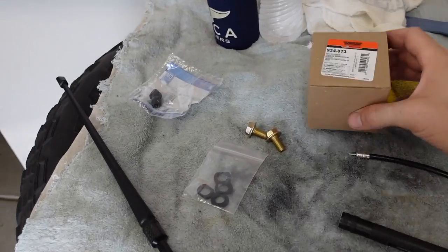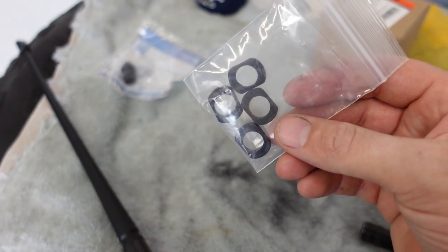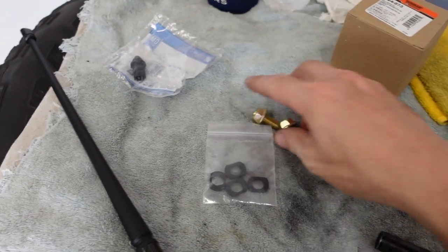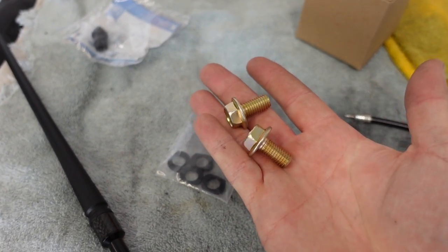Alrighty, so the kit for the seat is from Dorman. That's the part number right there. I will link it in the description for you guys. It actually comes with two seats worth of spacers, and I do have to do the passenger side, because that one is loose as well. It also comes with these two bolts right here. There is a stud that they tell you you can kind of pound out to make getting the track easier, but I found if you just slide the seat track to the back, you can get the adjusting mechanism out, so you don't have to do any sort of pounding or anything like that.